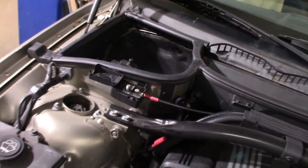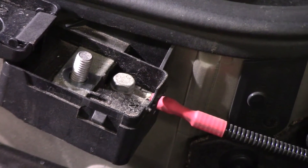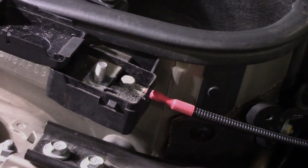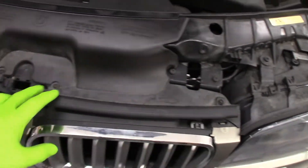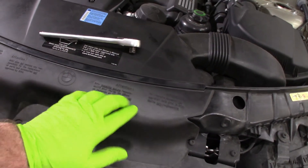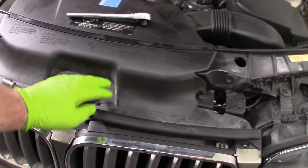We've got the main power off — that goes down to your starter and into some of your components. There's another hookup that goes into some of your computer components via a smaller wire. You want to disconnect both of those so no power is going into your computers while you work. Now we're starting by taking off this air intake cowl. There are four Torx screws to remove.